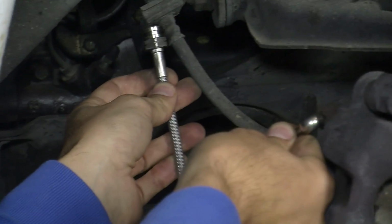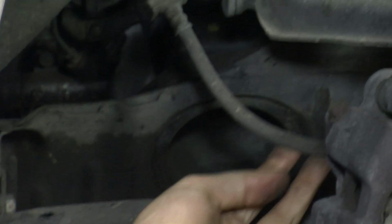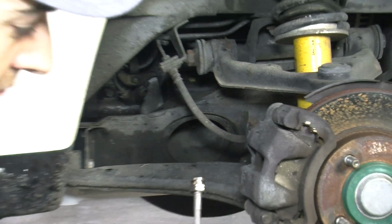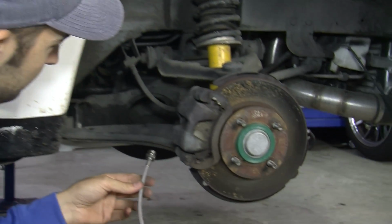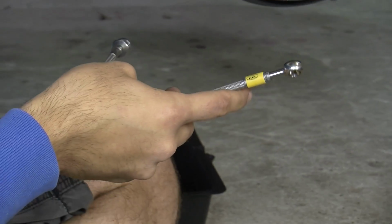And you can really see the difference, Marty, that when it comes down to the pressure there of having a rubber hose versus that braided line, I mean, in an ideal world with hydraulics, you would just have a fixed steel pipe. But being that this needs to move because it's connected to a wheel, then a braided line is the next best thing. Exactly.